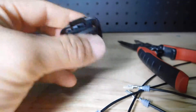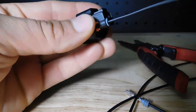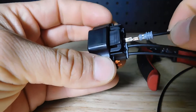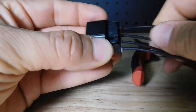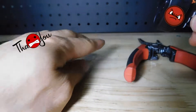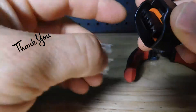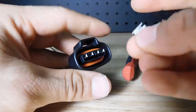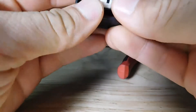So that's how to remove it. To assemble will be pretty much the same, just inverse. You push it until you hear the click — push it until you hear the click. If it's clicking, that means the tab is taking the position and locking the terminal. Once it's in the lock position, it's not removable. Then we install the TPA to make sure that for any vibration, or in the future as the plastic ages from heat, it probably can move a little bit. That's why this is like a safety system — making sure that the tab is not going to move from where it should be.